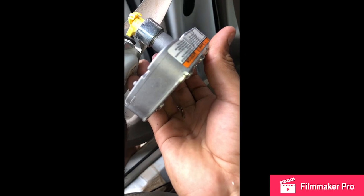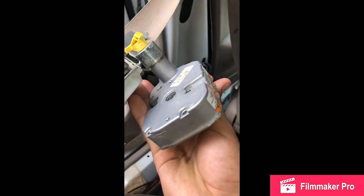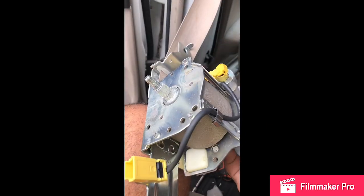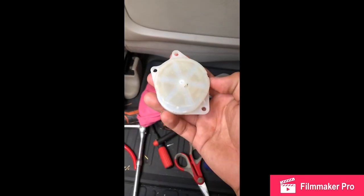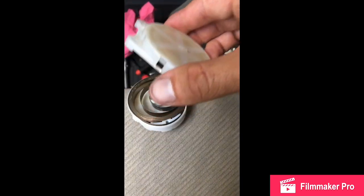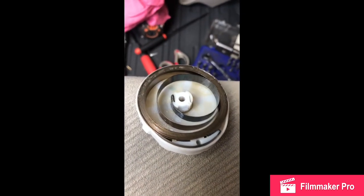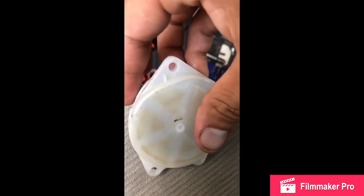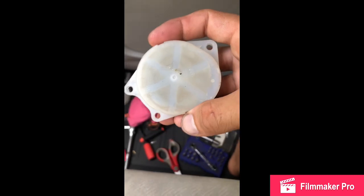Put the unit back together — that should help resolve your issue. There's one more step: reassemble this by aligning everything back so the bolts can go through and lock into the bracket. Then I'll show you how to set up the cartridge and coil it. Just in case the spring came off, you can take the cassette apart and ensure the spring is locked into one of those grooves. In most cases it's already in place — you can verify by looking at that little hole.